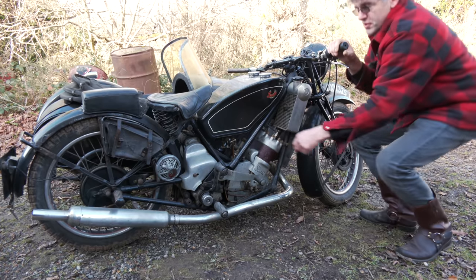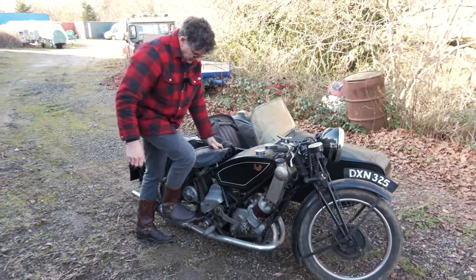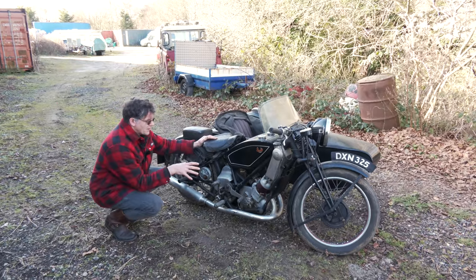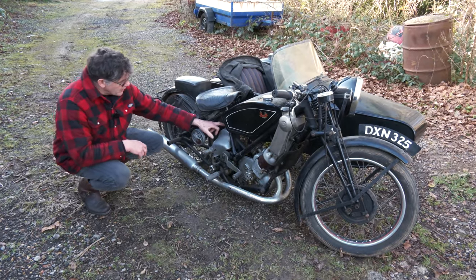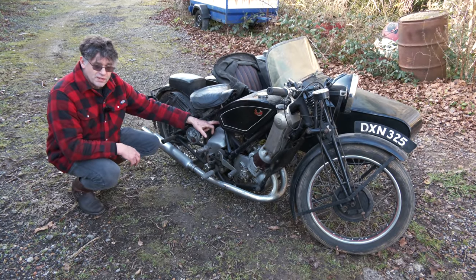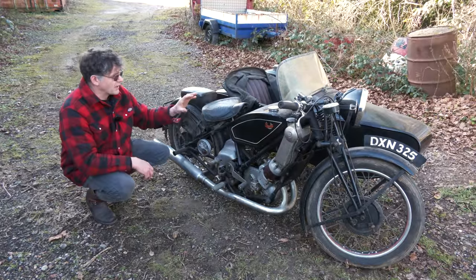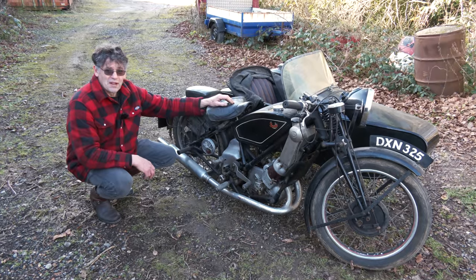It kicks over and we have compression, so I would say it's a good engine. It's not going to be a massive amount of work — as long as there's no leaks and we know the pump's okay, we clean the carb out. The dynamo we'll probably send off to a chap I know — he'll run through it and make sure it's working okay and give us a guarantee on that. Also recondition the voltage regulator — it's worth getting that done, because I've got a feeling the guy wants to take this to Ireland and do a bit of touring around. So we want it right.